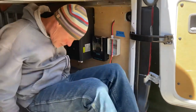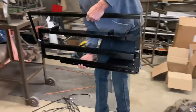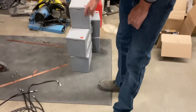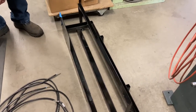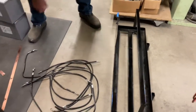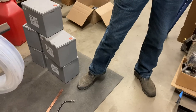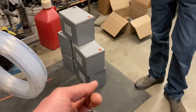My battery box for all those batteries — how many are you doing? Five. This goes up against the exhaust so I just made a little heat shield to keep it away from that plastic. This holds them from hopping up out of there if I hit a bump, and it just slides right up into that compartment. I did my bus bars to connect all the batteries together. I left just enough slack where I could lower this thing down on a floor jack, connect everything, jack up the floor jack to those two straps, then bolt it in. These batteries — they came from a cell tower, right?